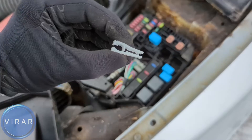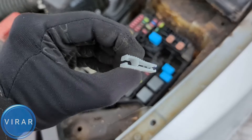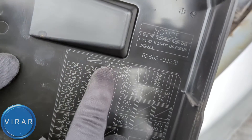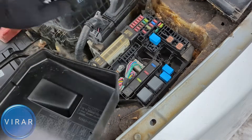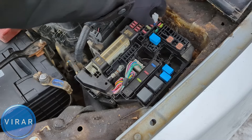Now let's get that white fuse puller. The way it works, it just goes on the fuse and then you grab it and pull — the fuse comes off with it. Let's focus on the fuse diagram. There is one fuse: 10 amp dome. That's the one for the interior light, right beside the spare fuses. So get the fuse puller and get the fuse off.